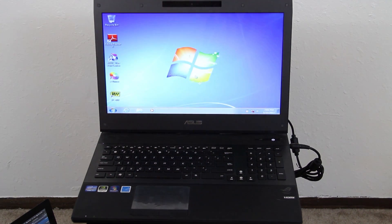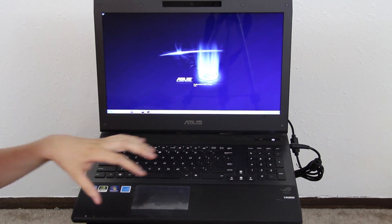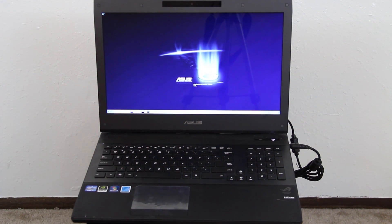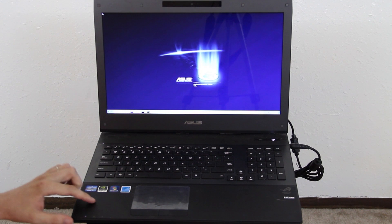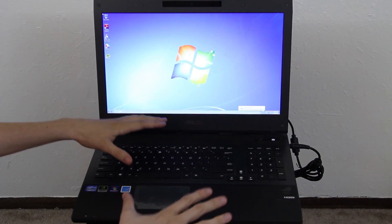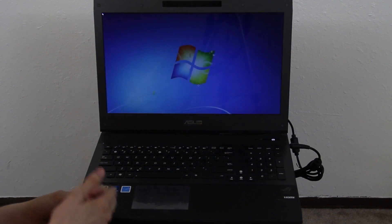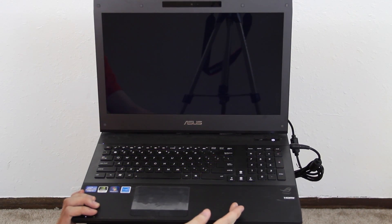I'll start to think maybe I had a wrong setting in the BIOS. It's probably rebooted honestly about 16 or 17 times, and this is the first reboot where the desktop is actually showing up at 1920 by 1080, so these reboots are actually doing something. For a second I just thought it was stuck in an Android boot loop. Each time it starts up it just takes seconds — mere seconds. It's freaking great, I can't wait to use this. Right now there's absolutely nothing spinning in this thing except the fan. It has a fan for the GPU and a fan for the CPU, so the hard drive itself is not moving since it's an SSD. When I hook the other hard drive up there's going to be one spinning whenever it's accessing it.